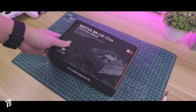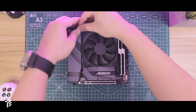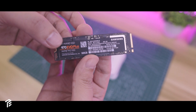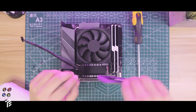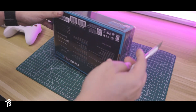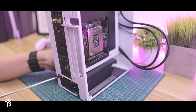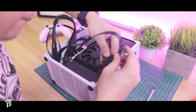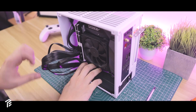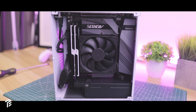For the cooler, I'll be using a Chromax Noctua L9i. I would go with a Black Ridge if I have plans to do some overclocking in the future. For storage, a Samsung 970 EVO NVMe Plus for faster read and write — based on my experience, this will boost loading times when emulating heavy games. Finally, we have a 300W FSP Flex ATX PSU. I think 300W is good enough for this build, but not future-proof. The cables are modular, which really helps hide unwanted cables when using an acrylic case cover. If you plan to add a 3060 GPU, I'd suggest getting a 550W PSU or higher.